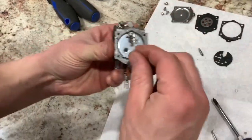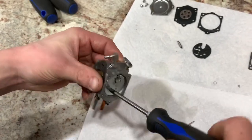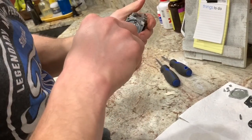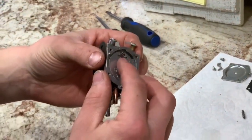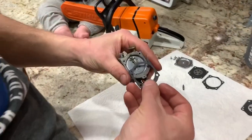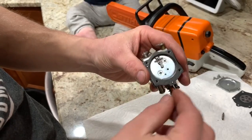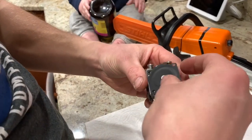I'm just going to get it snugged up so then you can release and be a little more relaxed. Put the other screw in — there we go. That should be that. Just ensure it moves nice and freely — that's good. When rebuilding these carbs, they really think about the consumer. They have all these pins everywhere that help you align things, so just keep an eye out for those; it makes it really easy putting it together. We've got the gasket on there, now we're going to go ahead and do the little diaphragm.